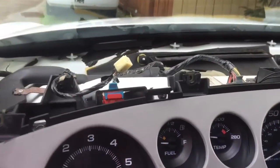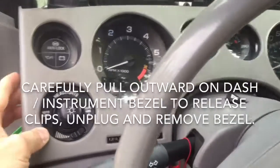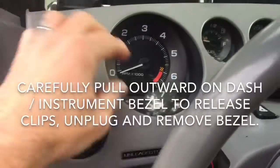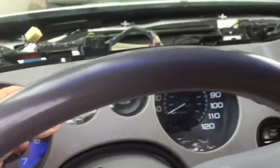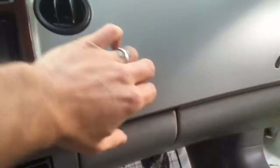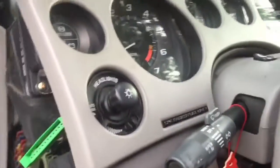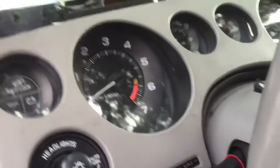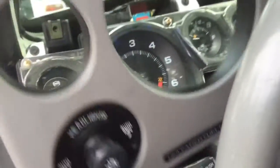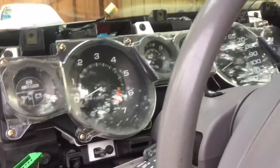It's one solid piece. I was lifting up as I was pulling out, and it seemed to come out very freely. After removing the top dash panel, you'll want to pull out on this plastic front cover and just work your way all the way down. It comes out pretty easy, unsnapping everything. There are two electrical connections that will need to be removed.